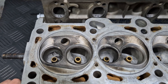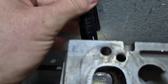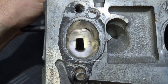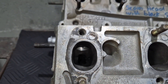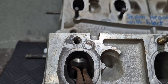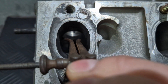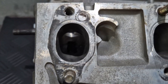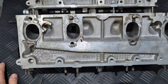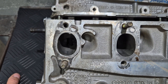90% of the time when guys go big valves, they mess it up. I don't know if it's a selling point — guys just want to make money by going big valves. Look at the standard exhaust versus this one — they opened this exhaust port up way too much, especially for the setup. This is a 1600 head, a 1600cc engine bottom end. By going this big, they literally destroyed the scavenging. Most guys don't even know what scavenging is. Scavenging is crucial in a cylinder head.